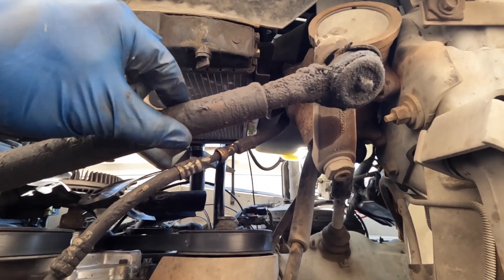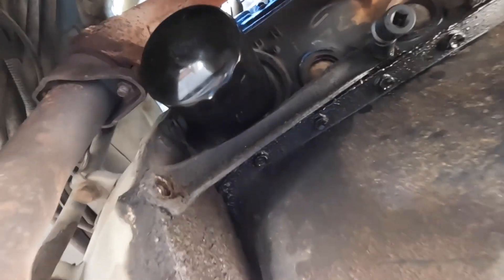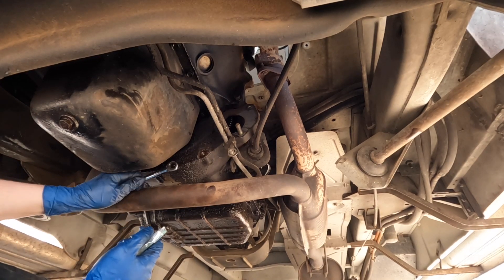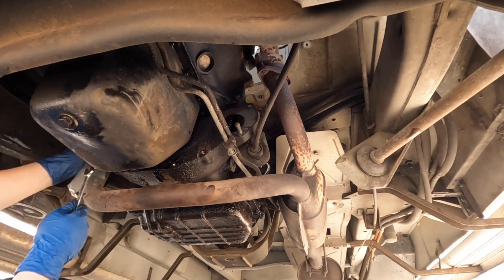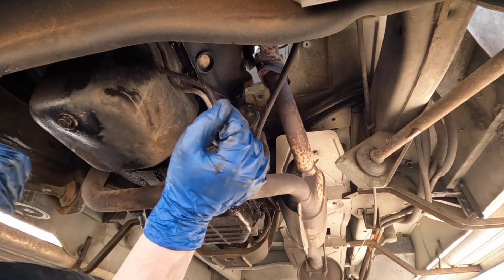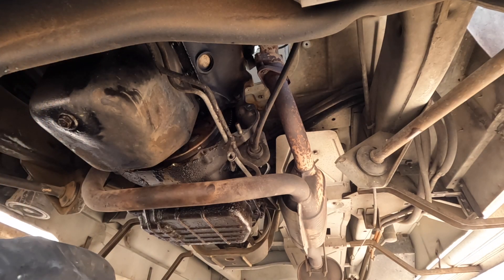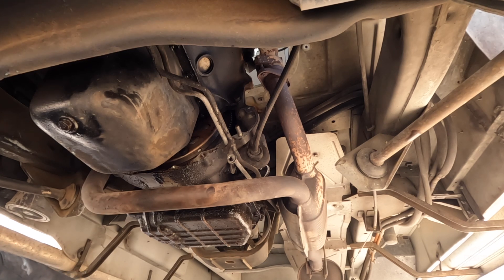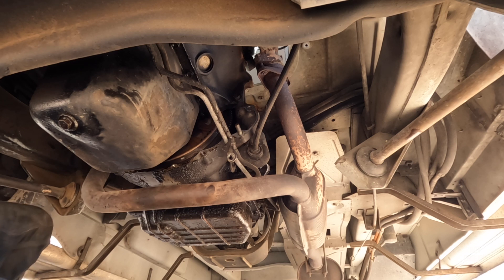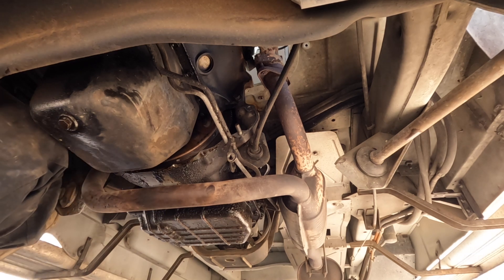It's just the steering linkage going to the pitman arm that is bad. Let's continue — I want to get the torque converter bolts next, so we're going to pop off the engine-to-transmission supports fully. I'm going to pop off the access cover — these bolts are 7/16ths. Now that we have the cover off, we can access the torque converter bolts. We can't spin it over by hand, so I'm going to grab a socket that fits the crank pulley — an inch-and-a-quarter socket for the crank pulley bolt. Now we're going to spin the engine over to access all the torque converter bolts. Spark plugs are all in, so it's building a fair amount of compression.